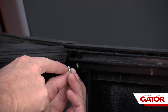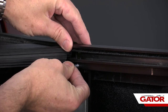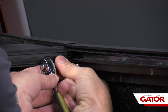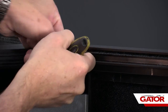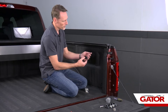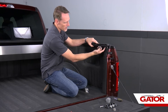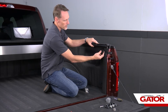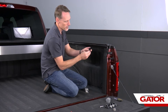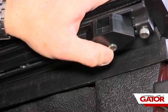Out of our kit we've got a self-tapper screw with a T25 head. We're going to thread that into that hole in the rail and make sure we work that screw all the way to the rail, but don't over tighten it. Next we're going to install our latch stops and our clamps — those are going to install up into that channel where we have those nylock nuts. The very last nylock nut, we're going to attach with one of our small Allen head screws going up through the bottom of that latch stop and into the very last nylock nut.